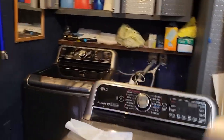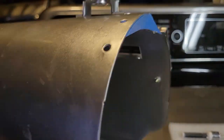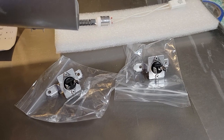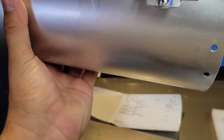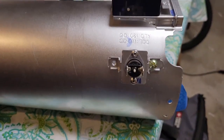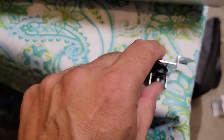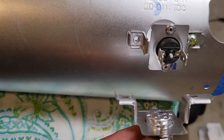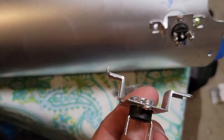These are the two thermostats I'm replacing. I found it easier to wait for the parts to arrive before removing the old ones and putting in the new ones, so I don't put them in the wrong spot or facing the wrong way. I'm glad I waited because there is a specific way the thermostat goes in — it's got a locking clip on the left that aligns with a lip, and the right side doesn't have that. The other one has the same thing, which makes installation easier.